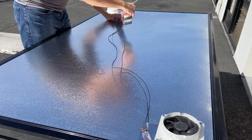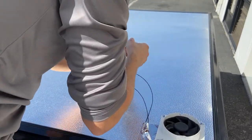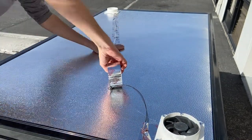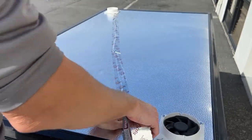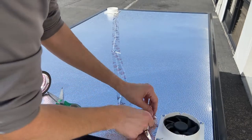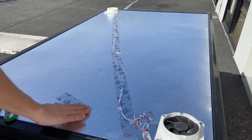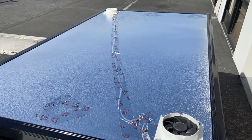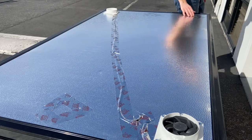Use the remaining duct tape to secure the heater wire harness to the heater backsheet. Use the last of the remaining duct tape to seal off the two unused intake and two unused exhaust duct hole options as shown, which will help prevent any unwanted air loss out of the backsheet during use.